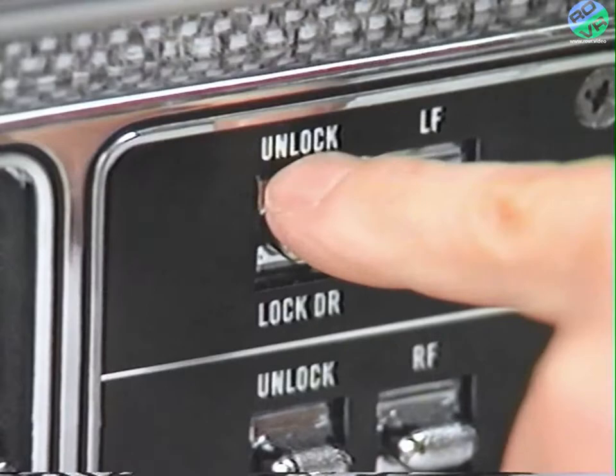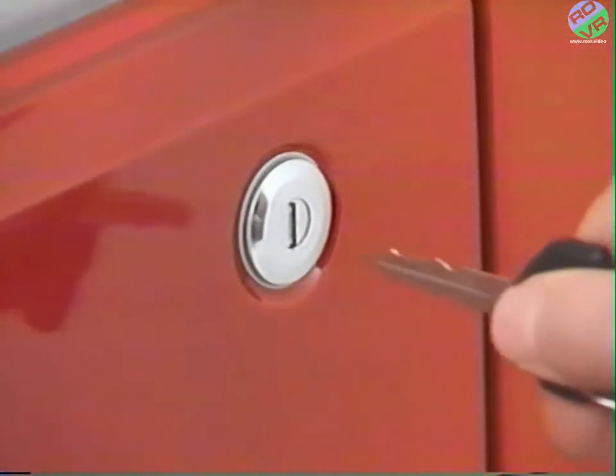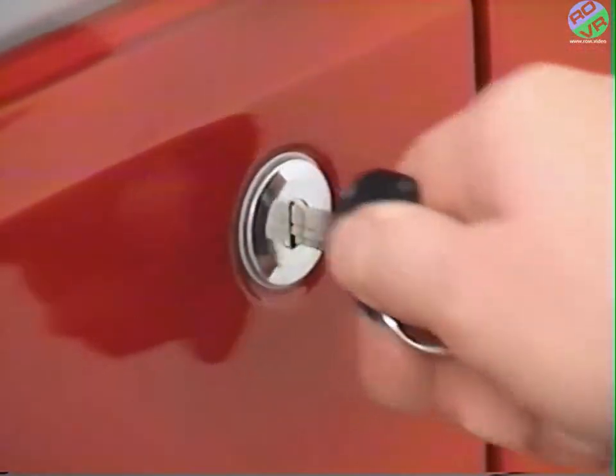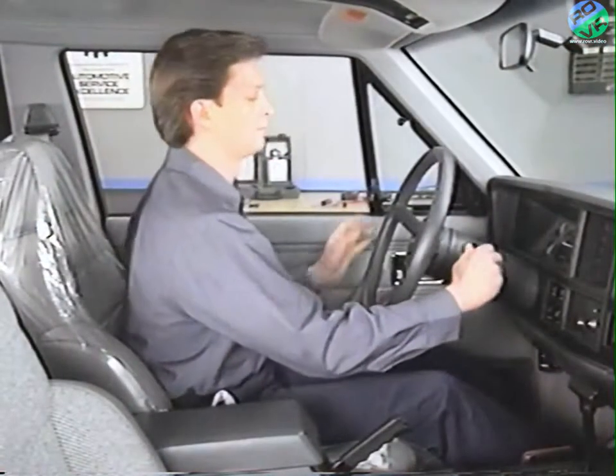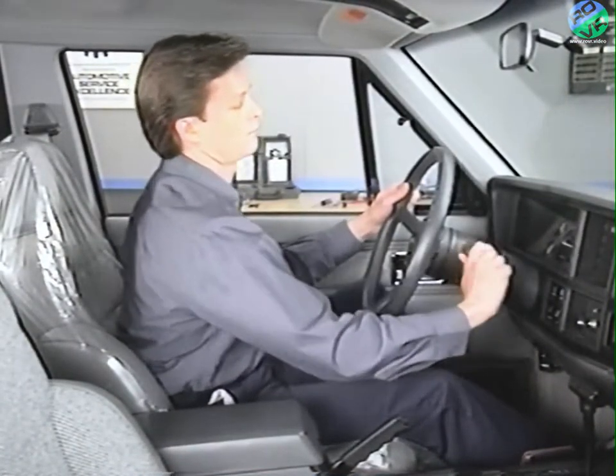The methods just shown are the only two ways to arm the system: engaging the power door locks with the doors closed while remaining inside of the vehicle, or manually cycling the key in the door lock will not arm the system. Remember, new vehicles must be started 20 times before the engine disabling function will activate. Vehicles that have had their engine controllers replaced will also need to be started 20 times before the engine kill feature will function. This should be done prior to customer delivery as part of your road-ready prep.